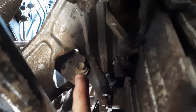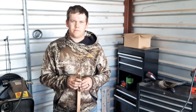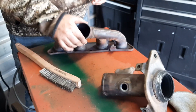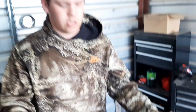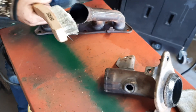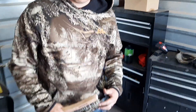If you can see it right there, that is a mount that holds on the manifold. For me it's the bottom half of mine because mine split. It's a 14mm, so I'm going to take that off. I'm going to be welding my exhaust manifold back together — the new ones are expensive, big cast iron things. I'm not a rich man and I buy tools to use them, and this is what I enjoy doing. So I'm going to weld it together, wire brush it, clean it up to try and get the best weld I can. It fits pretty good because of how it broke — there are little marks that meet up.